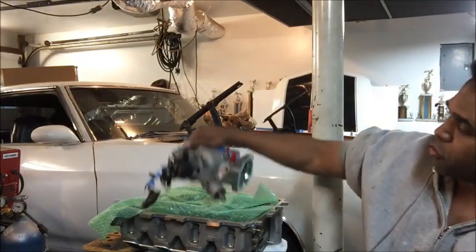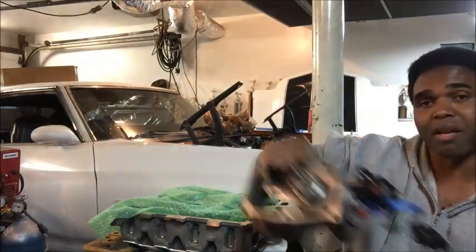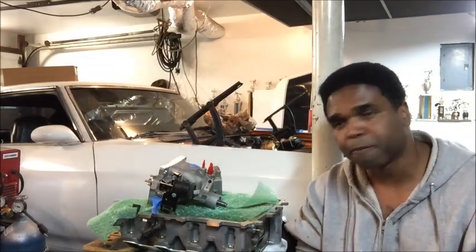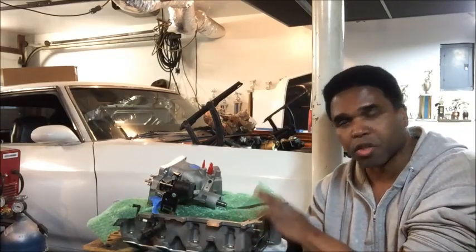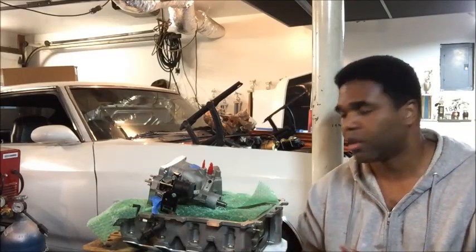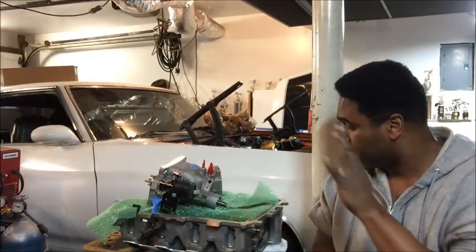It's a two-piece unit. You've got your snoot — and as you can see I removed the pulley because I'm going with a smaller pulley, one step smaller, I think it's 2.55 under stock, which will give me a little bit more boost. And then you've got your bottom half — this is the whole body of the supercharger. There are certain things you have to do to prep these two pieces before you reinstall on your car.